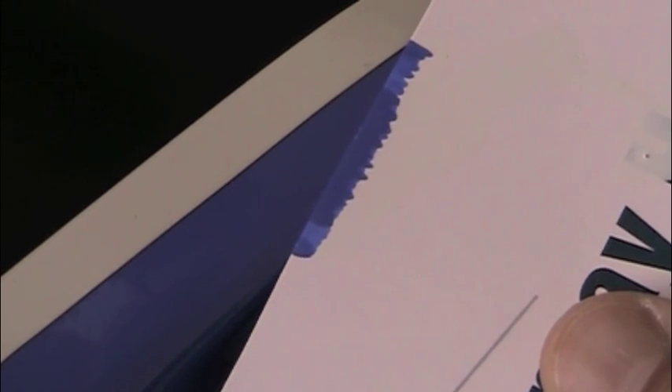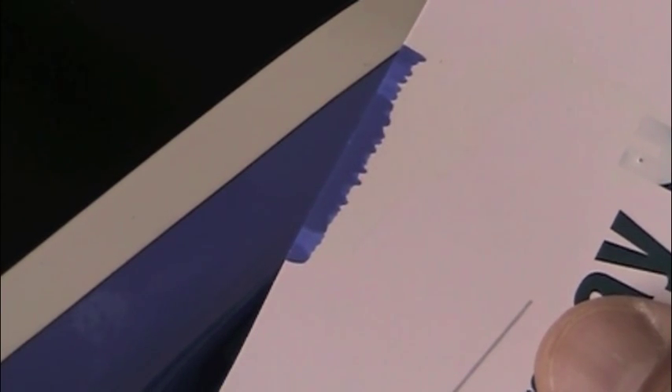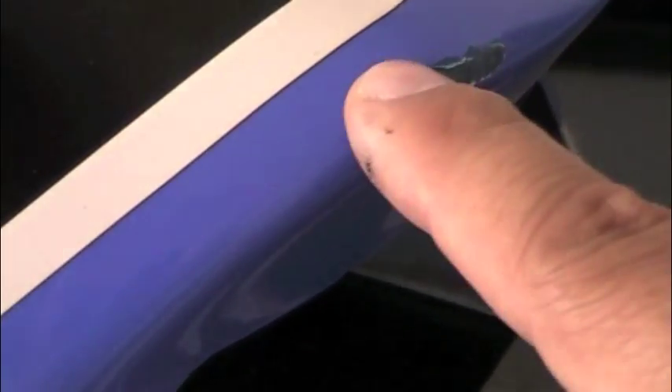I'll show you how it compares against the bodywork. As you can see, it is bang on — the middle part, two coats. They always recommend you do these test sprays, and there's the damage I need to repair with my marker. So watch how I do it. I've got to lay down the white base coat first. It's a little rough, and I may come back and do this at some point in the future, or fill this in properly and sand it down. But I've sanded this down a little bit with 600 grit, and I'm going to lay down my base coat, and then on top of that I'll put the color coat.